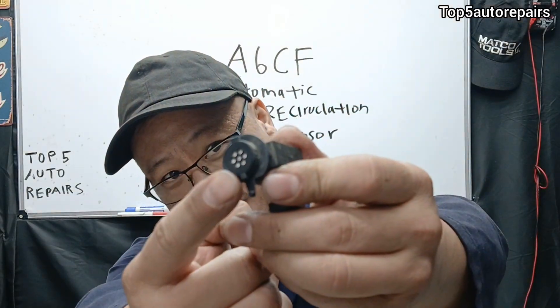The AUC sensor is a special sensor — basically it is a sniffer. This sensor is usually mounted in the engine bay and it detects outdoor pollutants. For example, if it smells bad air coming from the outside, it is going to close the flap in the HVAC system and prevent outdoor air from entering, using recirculated air inside the cabin instead.